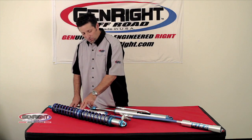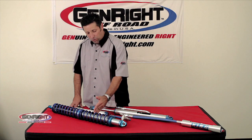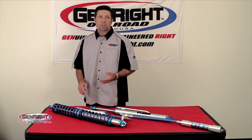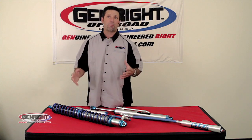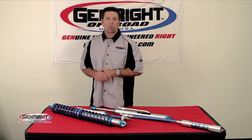In addition to this slider, there are a couple of nuts on here called secondary nuts. These nuts can be adjusted down the threaded body of the shock so that you can kick in this second spring rate whenever you want. That's part of the tuning — part of if you're going around a corner or if you're loading up your vehicle. All of these things are really nice features to make the shock work really well.